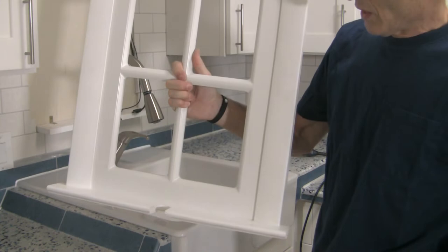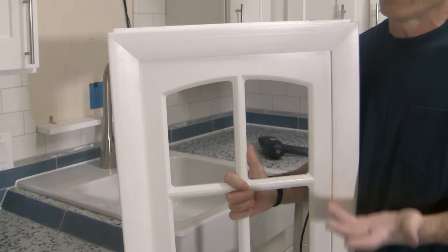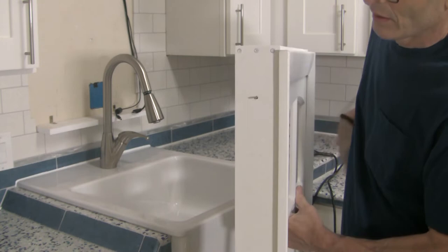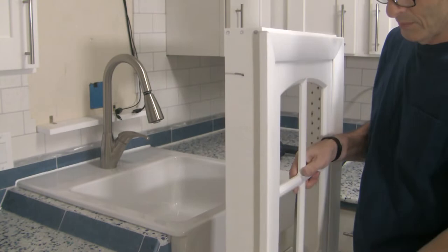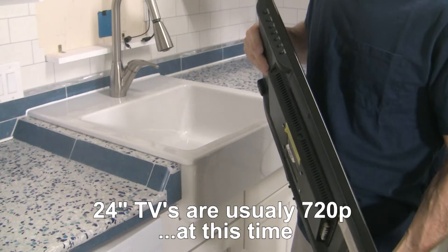The alternative was drilling a hole in the front for the infrared sensor, but that would leave a big visible black hole, so this wire plunger method is more incognito. Here's the 24-inch 1080p TV — 1080p is unusual for a 24-inch unless you use a computer monitor, but that's fine as long as it has an HDMI. Here's the on/off button that the little wire will press.